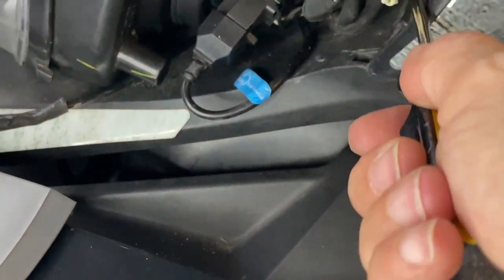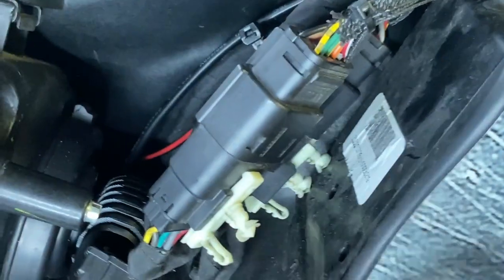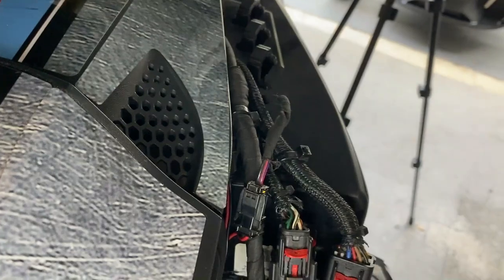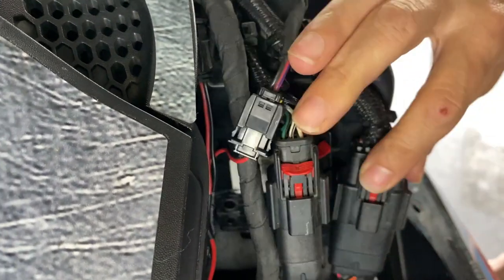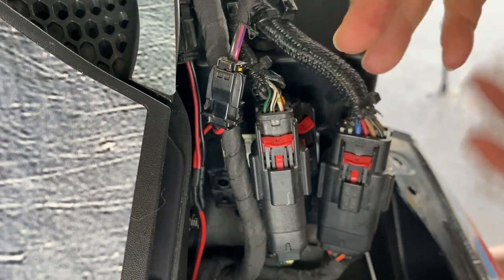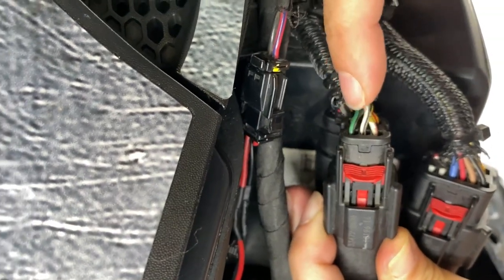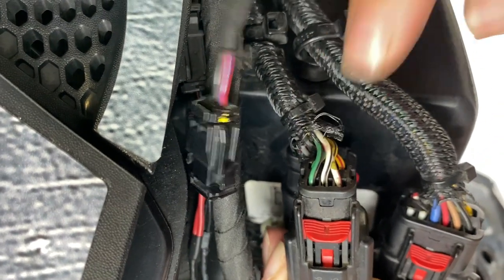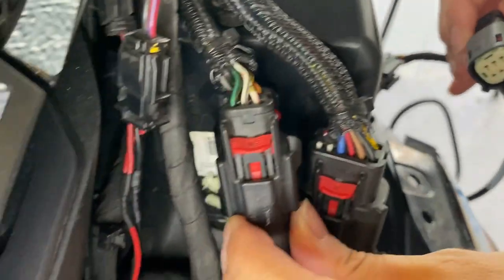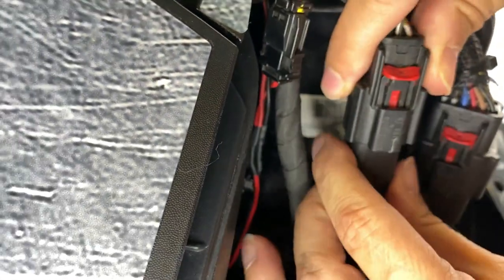There's a push-pin system — get your screwdriver in between the two pins and pop it off. Do the same for the other ones, including the back one. Now with the adapters exposed, it's hard to tell which of the left two to use since it depends on how the bike was assembled. You're not using the big one — you identify the correct one by the wire count. The six-wire connector is what you use, since the Pedal Box uses six-pin adapters. The four-wire connector is not the one you want.